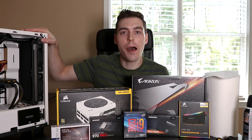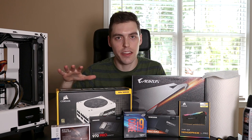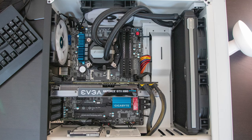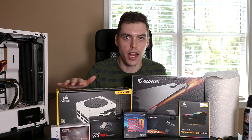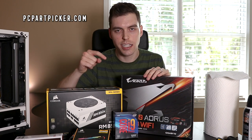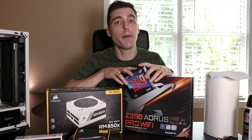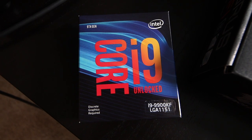One more thing: if you are upgrading a current rig to a new rig, I would recommend taking pictures of your rig in case all these new parts don't work and you need to go back to using the old parts. Take very high resolution pictures of your build — both front side and back side — so if worse comes to worst you can zoom in and see what cable was plugged in where. Also, if you're looking to build your own system, I recommend using a website called PC Part Picker. I'll put a link in the description — you can build out your list of parts and it will tell you whether they're compatible. You need to make sure when you buy a motherboard that your processor is compatible, and that your RAM is compatible with the processor and the motherboard.